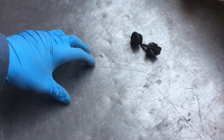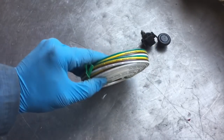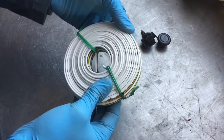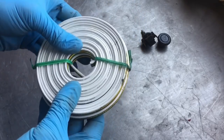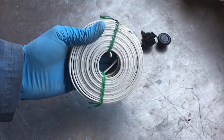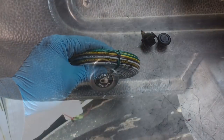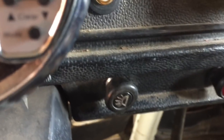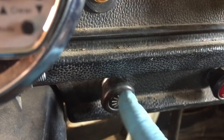To get the signal from the heater itself to the front where I can control it with a switch, I use this four-wire trailer wire — it lays flat, so you can run it in tight spaces. Army, who I'm installing the heater into, has had this stuff installed for about five years now, so I'm just using one of the wires off of that to trigger the relay. There's the light switch, and on the other side of the steering column is another little light switch. I like to think that this is kind of like the blower vent blowing air out.